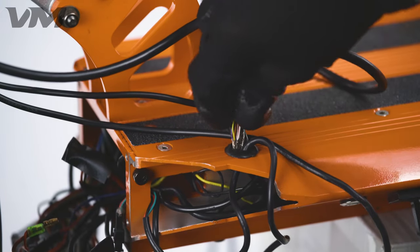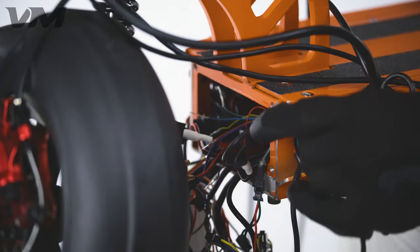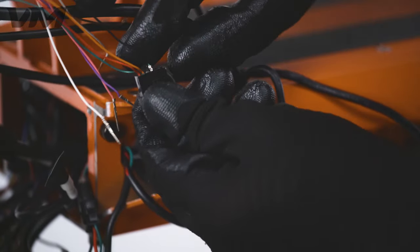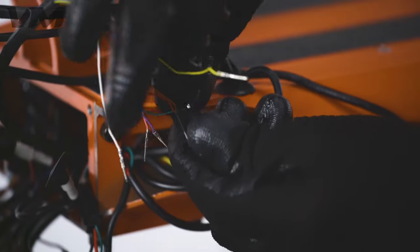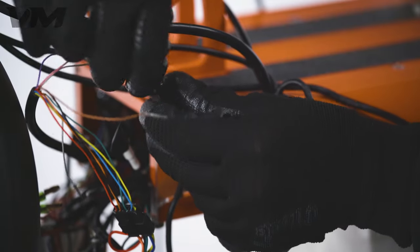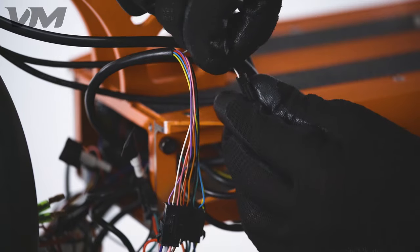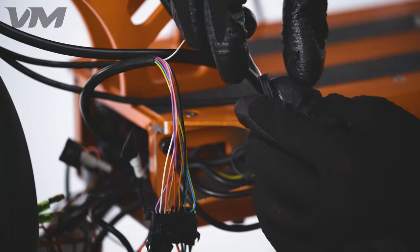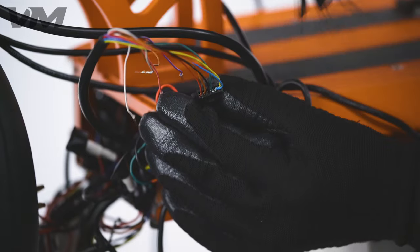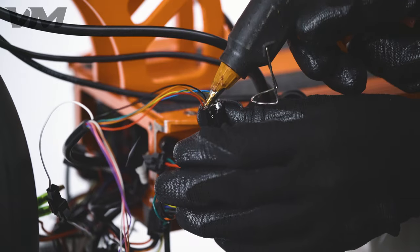Now pinch the pins and push them through the small hole on the footboard and then into the main cavity. You can start placing the pins into the cable connections now. Match the colors up with the corresponding connectors and then start pushing them into their slots. The six pin will take the red, orange, black, green, blue, and yellow cables. The four pin will take the brown, pink, gray, and purple cables, and the two pin will take the white cable. Be careful to make sure all colors line up correctly, and be extra careful not to mix up the white and gray cords. For any pins having a difficult time going in, use a larger blunt metal piece from the set and push them in. Once everything seems matched up, push the connectors back together and hot glue the wires to their new terminals.